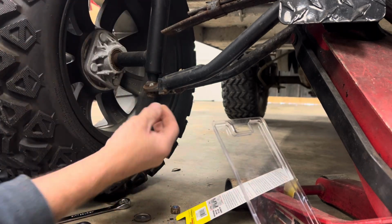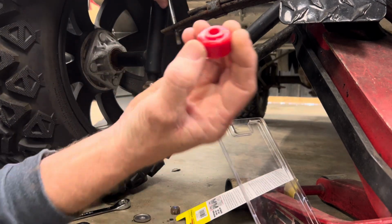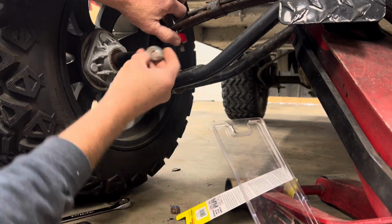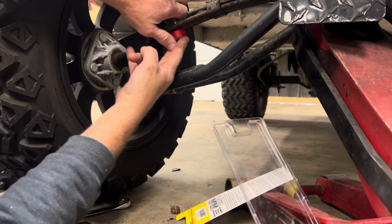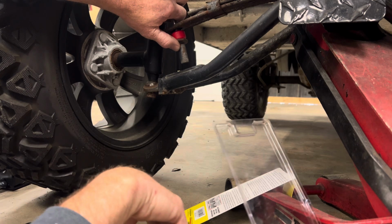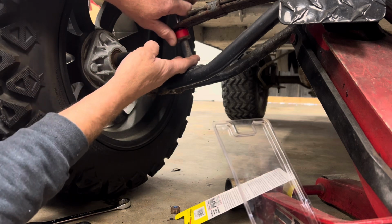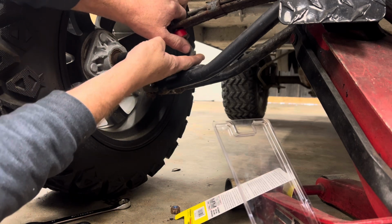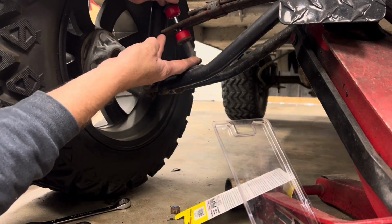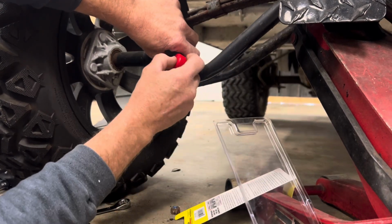All right. So you want to put it in there. Like I said, put your bushing at the top part so it goes toward the metal. Then your plate. Then your sleeve again. So you've got bushing, plate, sleeve. Then another metal washer, or retaining washer, what they call it. Alright, got that there, and then you put another bushing with the bevel part down.